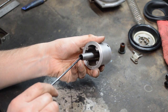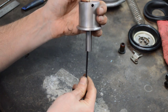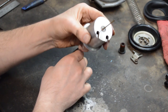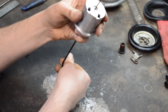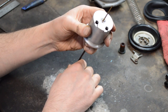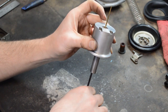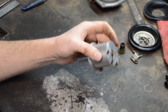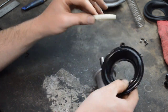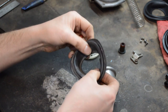For the needle, there's a hole here and a slot here — those have to line up. Put in your screw. You can see the needle moving up and down as you screw it in and out. The base setting is to have the needle basically just flush — the shoulder part of the needle, not the needle tip itself. That's your neutral setting. I've got a different diaphragm that's thinner material, and I think that's going to work nicely.